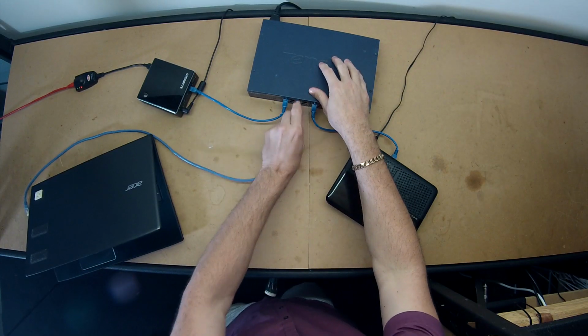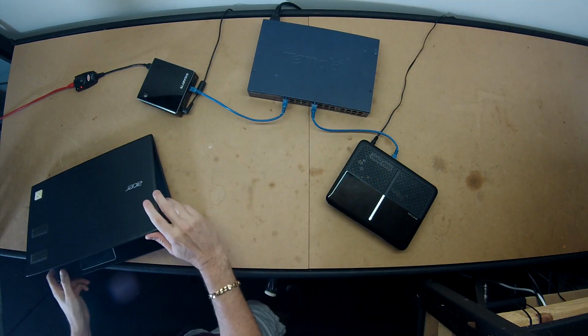Okay, so we've got wireless on here now, and of course in the future we're going to go right into wireless, but it's important to note that wireless is basically layer 1 and the bottom half of layer 2 in the OSI model. Okay, anything from there upwards is all the same, whether it's wired or wireless. So that's why I went through that OSI model before, because it comes up all the time. It's important to know where things sit in that model, and makes it a lot clearer when you're trying to conceptualize the whole system.